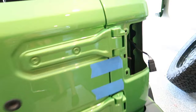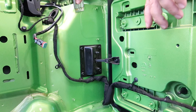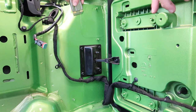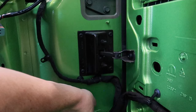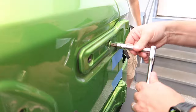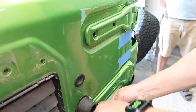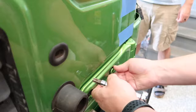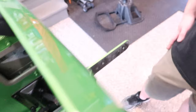We used some blue painter's tape to mark the tailgate so that we know if it shifts or moves, and we also need to shim underneath so the tailgate doesn't drop when we start unbolting it. I undid these three bolts here to pull the hinge out, and I've got to do the bottom three down here which will release that hinge out of there.